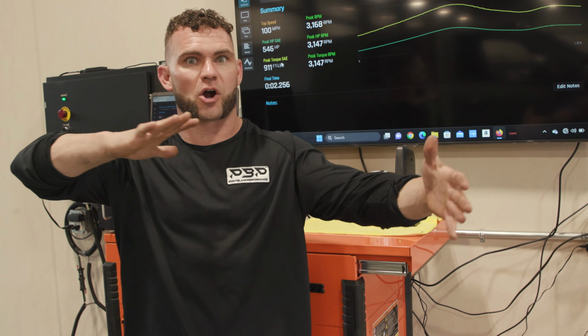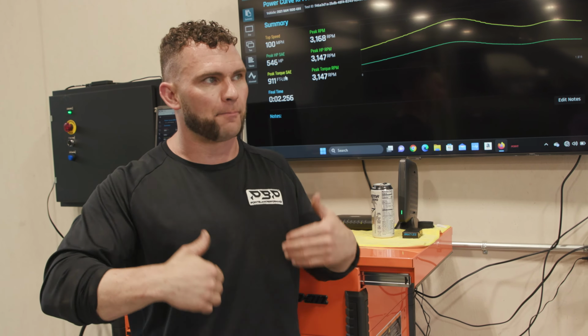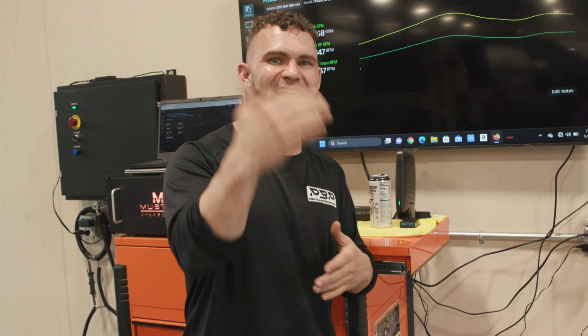So what I'm gonna do, I'm gonna hop back in the truck, same file, and we're gonna lengthen our RPM window. When I lengthen the RPM, start it sooner, I'll put it under a load, and guess what? The charger will work harder. Now we wanna see this thing break into the next digit. Let's make a pull.